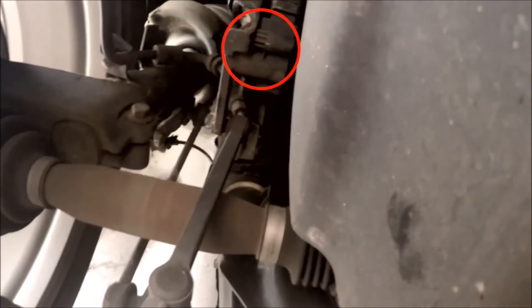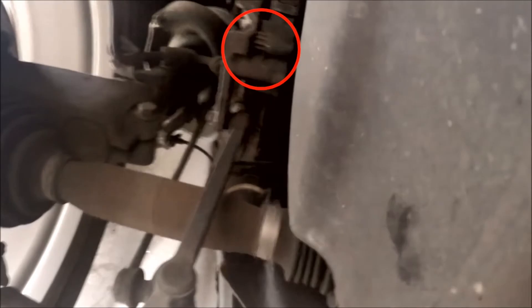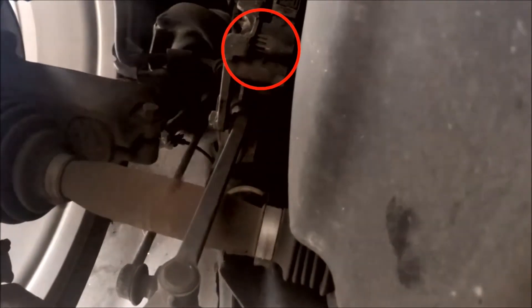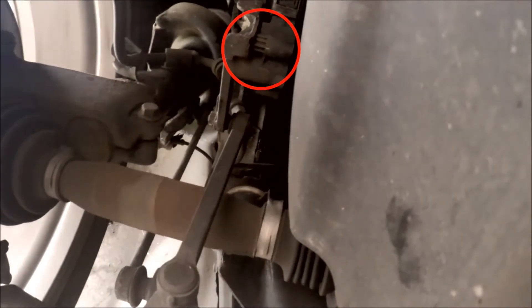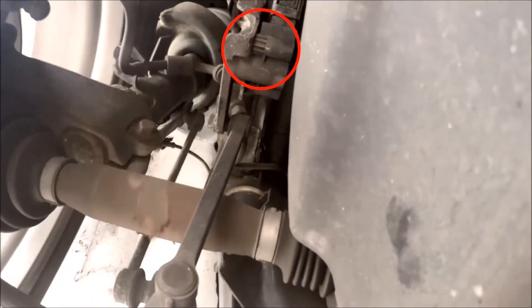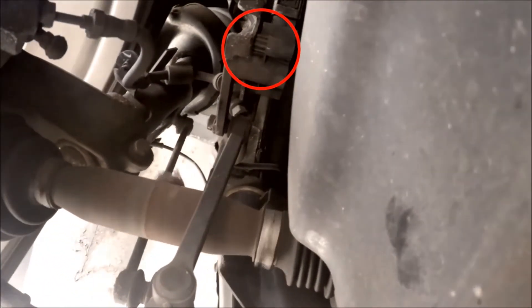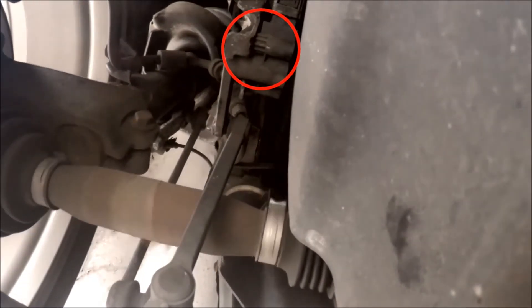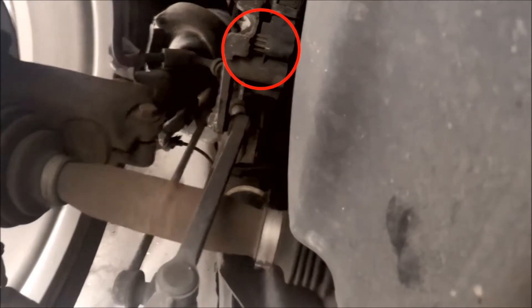For these vehicles, Moog has added an M6 blind rivet to all these wishbones. Therefore, where Xenon headlights are fitted as an option, the height sensor arm can be attached to the wishbone without having to purchase extra components to complete the installation.